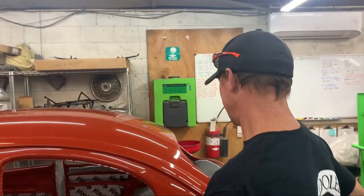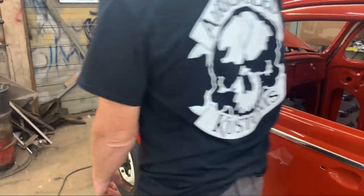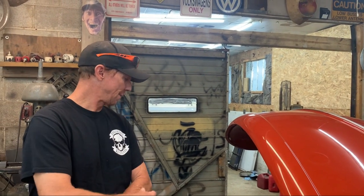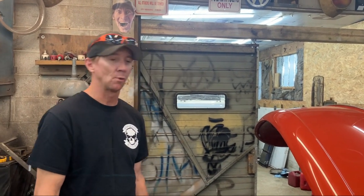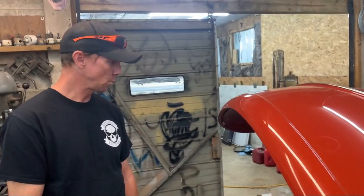Then we have Mr. Hershker's '60 over here. We've done little stuff on it — put the body trim on it, talked a little bit about the hood deal. We put the antenna on, but we're just kind of waiting. He ordered the headliner and it's going to take 16 to 18 weeks. So I can't do anything else because we've got to wait for that to put the windows in and all that. I don't want to put carpet and have it sitting there getting trampled all over. We're in a holding pattern on this one. We do have all the little parts but we can't put them in. We've got the wiring harness we're waiting on, which is being custom made by Rebel, because it's a six-volt car that's going to have semaphores that he wants running.